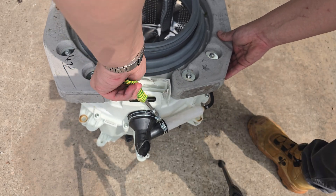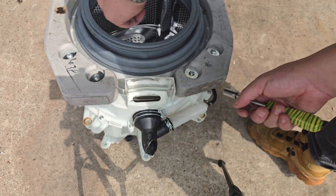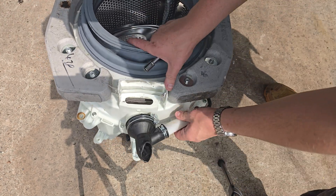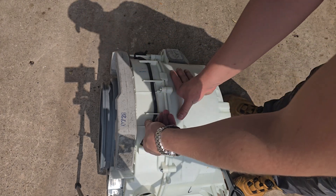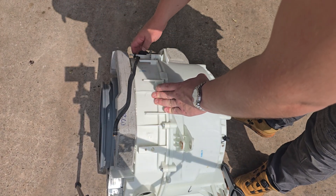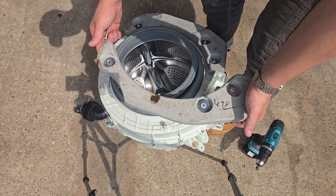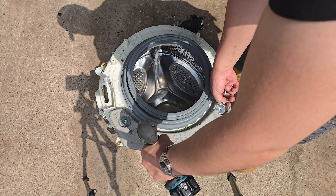We'll come back to the heater. The sump hose allows water to feed into the drain pump. This model has the pressure switch pipe attached. Boiled down, this basically reads the water level in the machine and feeds that information back to the board. It's rare that this pipe or pressure switch fails — if the machine's overfilling, this is where to start.